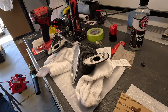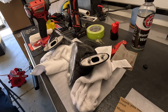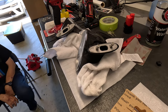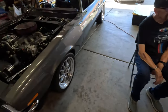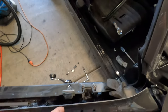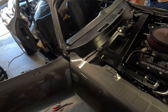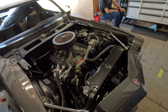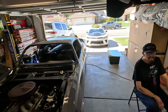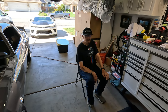I won't mount these in the car yet. This video will be a two-day session but all in one shot - we'll come back and show you how it all dried up, peel off the plastic, and mount them to the vehicle. We did have to cut out the passenger side - I bored out those holes bigger and touched them up with chassis black so we don't have any rust issues in the future. The car is ready for the mirrors to be mounted.